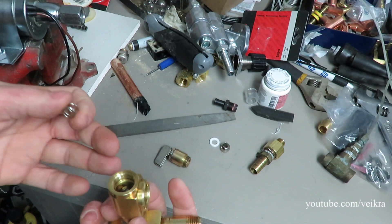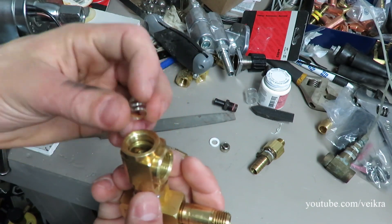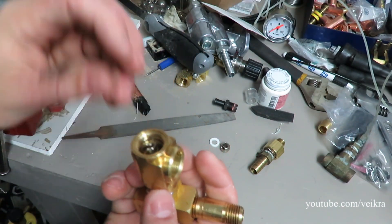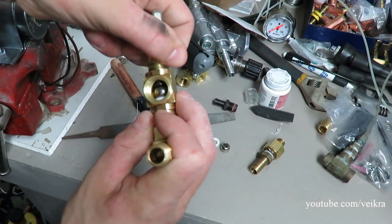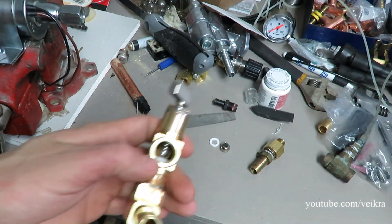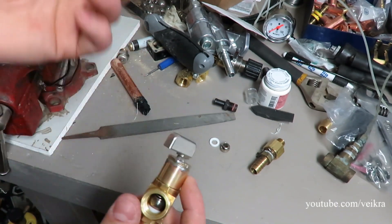Because all I'm aiming at is 5 psi. This spring I cut it to length and stretch it out a little bit and test it with a gauge, just on the bench. You put that there, solder the part that was here back on there, and now you have a 5 psi fuel regulator. If I want it stronger, I can put some washers in there or elongate the spring and make it 7 psi for instance.